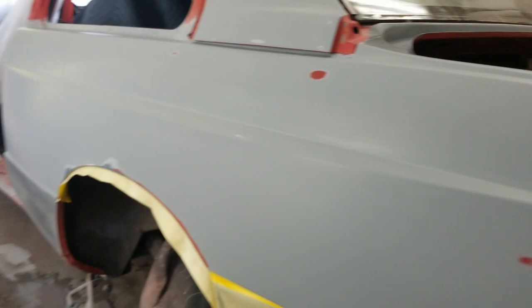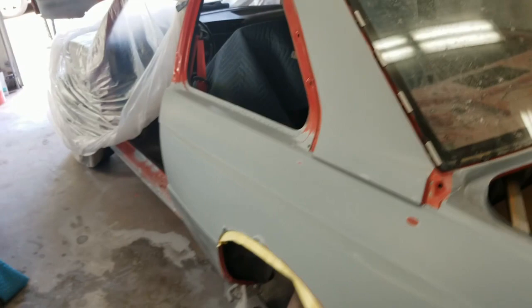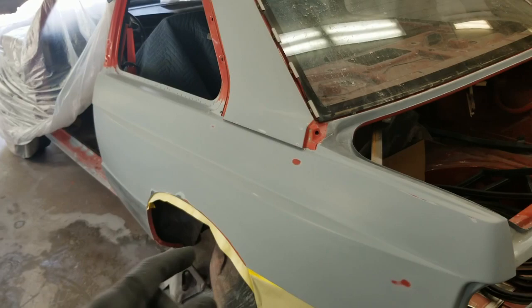It's just about ready. But I gotta touch up these wheel arches. Everything is straight as I can get it. I don't know if you can see down the side, but it'd be more obvious with it wet, but everything's flat except the wheel arches. I'm gonna get this spot primed here, and I'll put a couple of coats of high build primer over this area. I need to be able to block that, but the other side's okay.